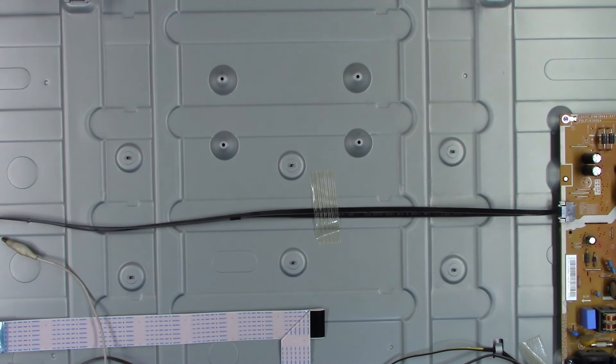I suspected it when I saw that flash — it had a dim area and defective LEDs. If I find the strips and get this thing going, the backlight is going to be at 100%. If you want to save your TVs, turn the backlight down — they run the LEDs basically at 100% and they're not going to last in the long run. Take it down to 50% or less. I have a TCL TV set at 50% and I increased the contrast and brightness to make up for it — that doesn't change the backlight level, it just manipulates how the LCD panel turns on and off. Thanks everybody, have a great day!